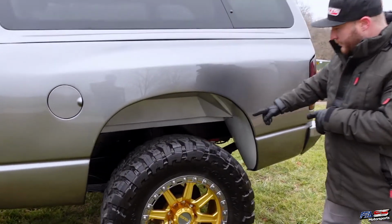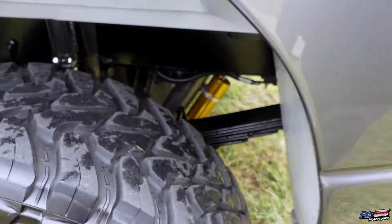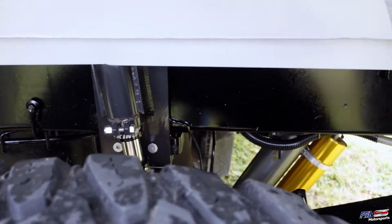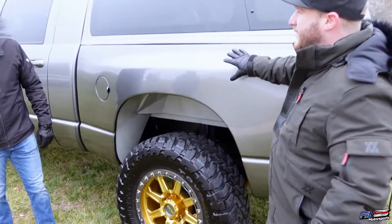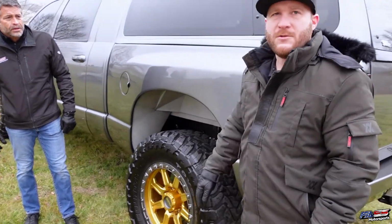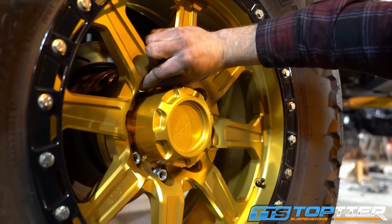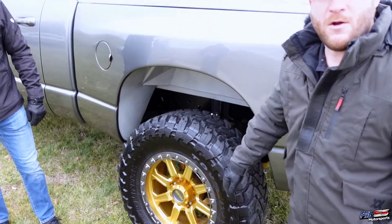In the back, you can see the 3.0 King shocks, the Dominator shock package, and then also the speed bumps, or the nitrogen air bumps, that are installed on it, all Carli parts. And then pan back a little bit. It's got fiberglass bedsides and fenders, but we also want to feature the Gold Innovate wheels. That's their G500 wheel package in a 20-inch, and then a beadlock wheel. This is a simulated beadlock, but we're running all ARP hardware on it, 12-point hardware.